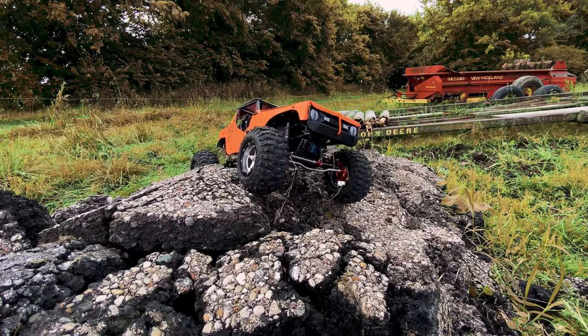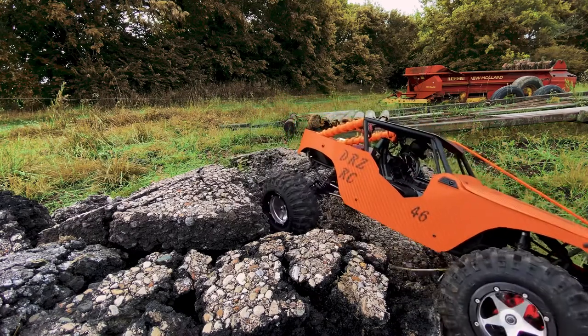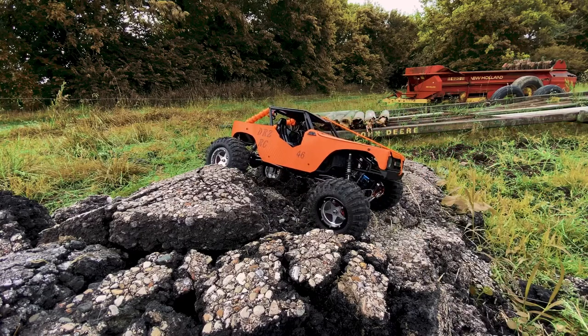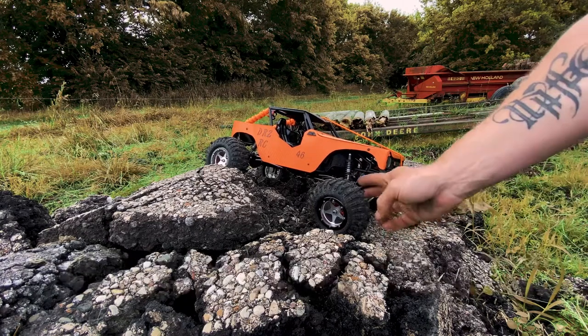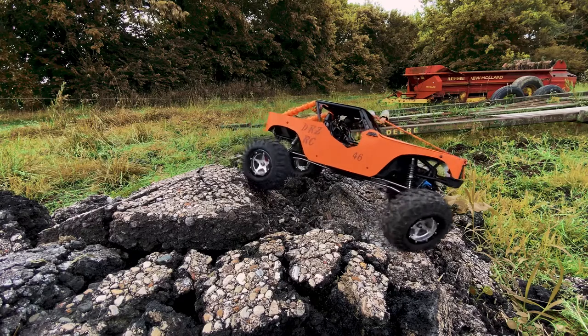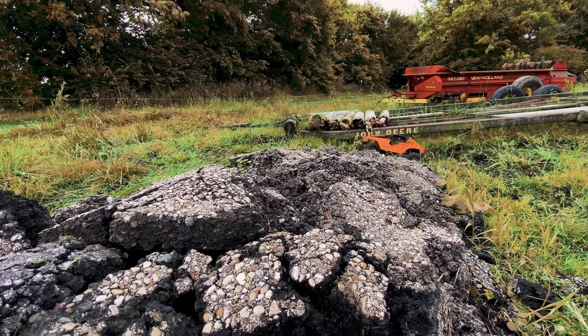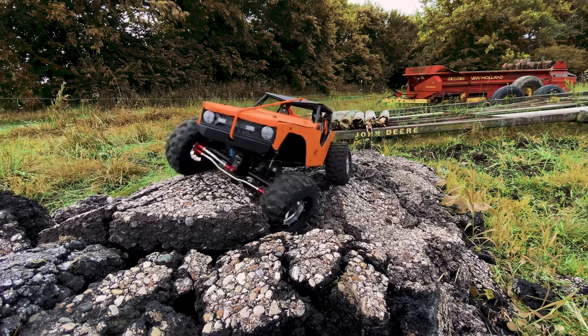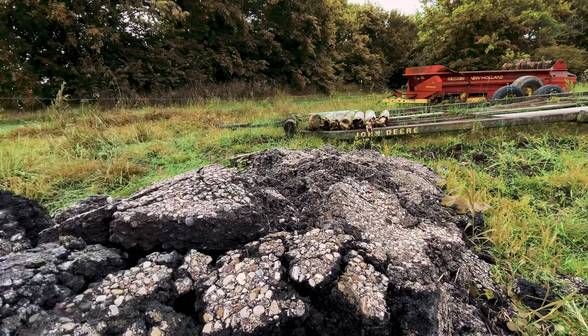They're still pretty firm, but it's definitely better than it was. On this particular setup here, the tire's bulging out in the center, kind of giving me less of a contact patch. They seem to be doing a lot better than it was before. So, that's a plus. Mushing down a lot better than they were. Let's see how it does on the good steep section here.